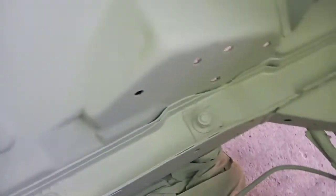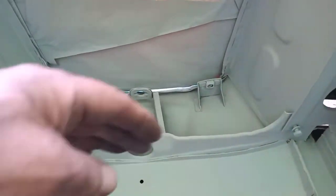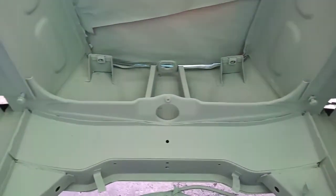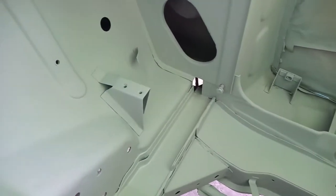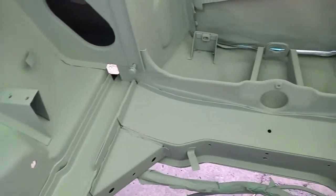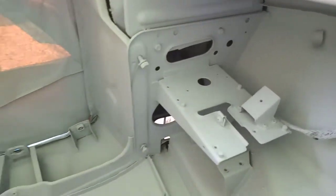So that's where we are at the moment. There's a little view to the front, underneath the front. All this has covered it over with the radiator etc., but I'll tidy all that up at a later date when it comes to getting finally finished off. I'm quite pleased with where the paint's gone. I'm going to leave that now for a few days to dry and to set before I go any further. I can give it a light little rub down with some very fine wet and dry just to get any blemishes out of it.